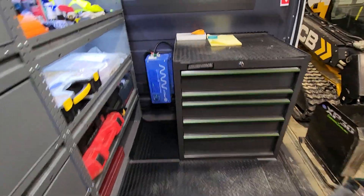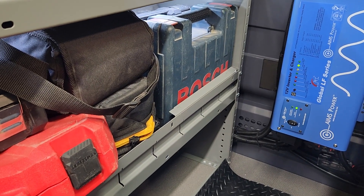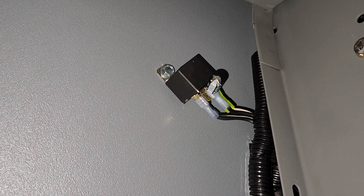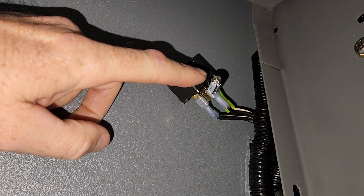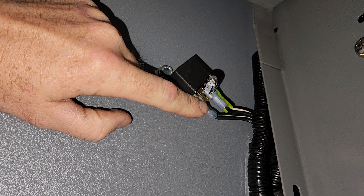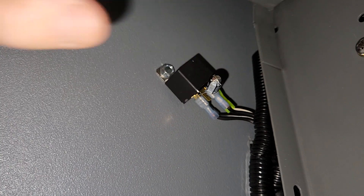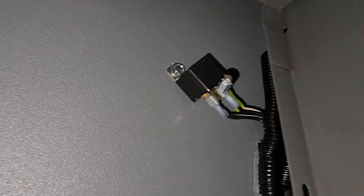I'm going to change my camera and get my light turned on so you can see — it's a little dark down here. There is the relay that is controlling my lights. What I ended up doing was installing this capacitor between the line side, which is the battery voltage, and the load side, which is the lights. That made it quiet, as you can hear.